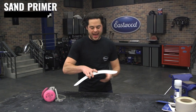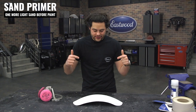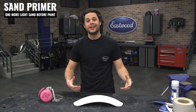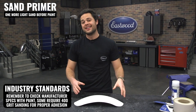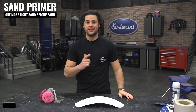Back with our epoxy primer and this is looking super nice. That stuff just flows out super smooth. This is pretty much ready to go; however, I did see a couple of small specks of lint just in our primer. We're going to get that sanded up to 600 — that's going to take care of that, no problem. Then we're going to head back to the booth and lay down our base.